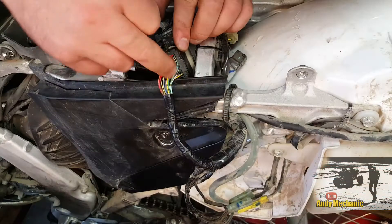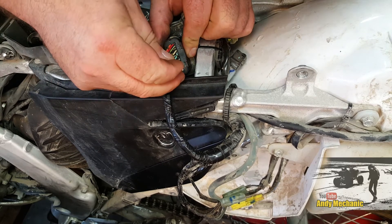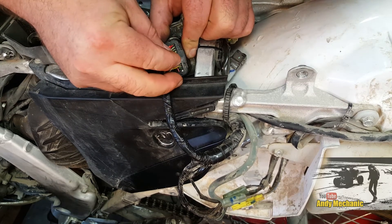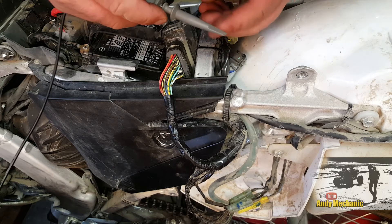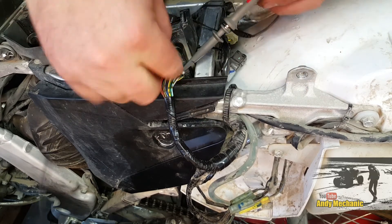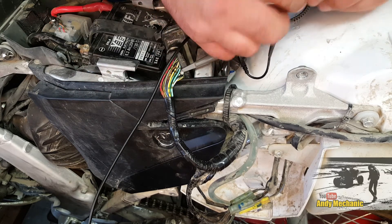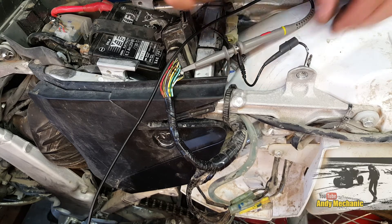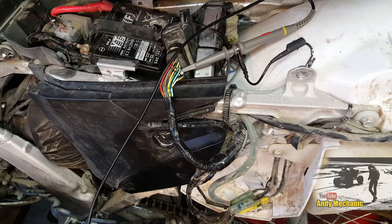We'll head over to the bike, I'll show you which wire it is on the ECU, and we'll get it all wired up. The wire we're going to use is the white wire that goes into the ECU. I did have some problems getting a connection on this one, but hopefully that feels pretty good. Make sure if you're using these little pins you're off the plastic — there's a little bit of plastic near the end just underneath that little ball, and quite often that can trick you into thinking you've got a good connection. We'll just go onto the frame for a ground.